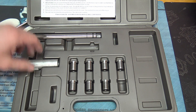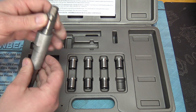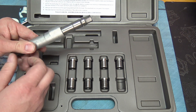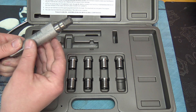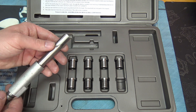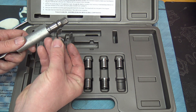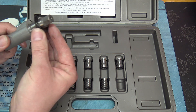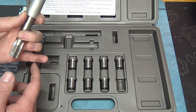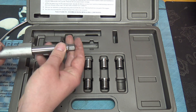For tapping the threads, the kit includes a nice high-quality tap that uses the same guide so you go in nice and straight. Thread the tap through the bottom of the guide first, then take the whole assembly to the spark plug well and start tapping. The kit wants you to go to a specific depth — they reference a V-channel slot on the tap. I felt it needed a positive stopping point, so I added clips from the ATD three-valve kit to create a definitive stop at the correct depth channel. After tapping, pull the whole assembly out.